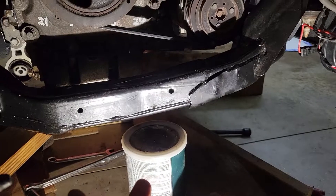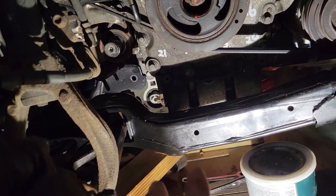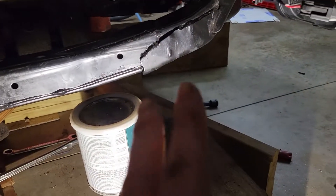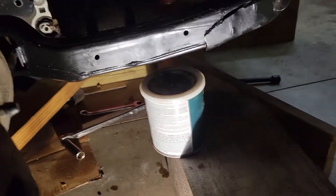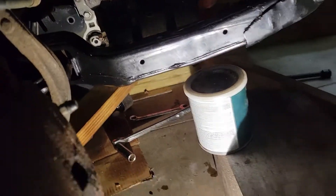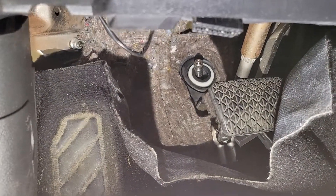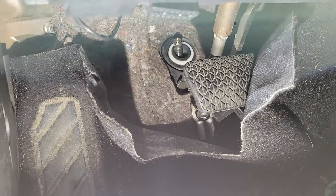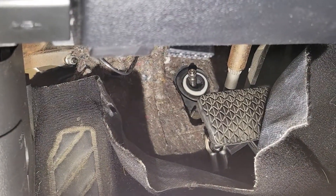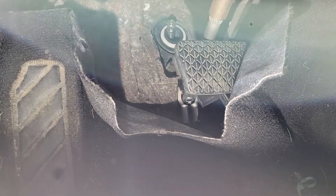Just take your time little by little. You've got a jack under that mount back there — that's pretty centered, that's where all the weight is. You're able to lift the front yourself and just put items under it, but four corners, slow. The only tricky part — well, it's all tricky — but coming up through there I almost punctured that boot. I had to finagle with the boot to get the spline shaft through there once I got up close to that hole, but she's good now.